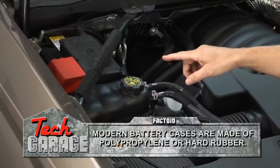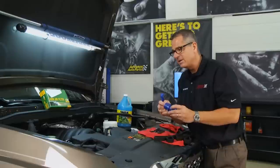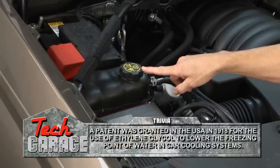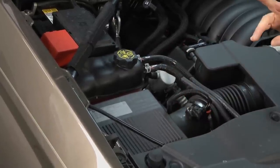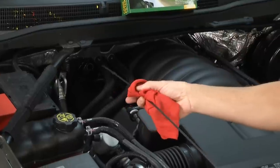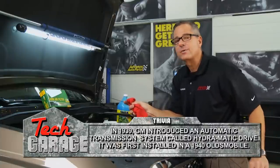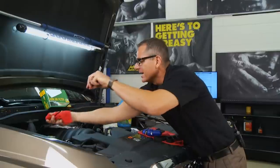On the other side of the vehicle is the battery — located right here. The terminals may need attention; you can get terminal cleaning kits to clean them off and ensure a good connection with no voltage drops. There's also the coolant system — the antifreeze needs to be topped off when it's cold. Your air filter is right here as well. Then there's the transmission fluid — pull the dipstick, smell it, look at it. If it's pink and milky, coolant may be getting in there. Check your owner's manual for whether to check in park, hot, or cold.